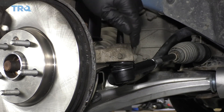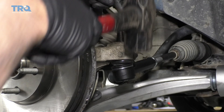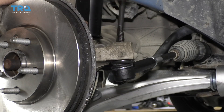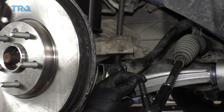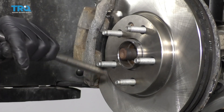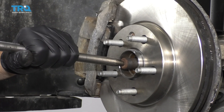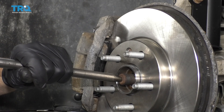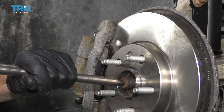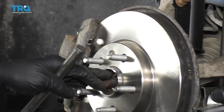Now I'm going to remove the stud from the knuckle. I'm just going to use a hammer and carefully hit on the stud — you don't want to mar the end of it or mushroom it. You want to make sure the axle is loose from the wheel hub, so just use a punch and give it a tap. Just make sure it moves in a little bit. I don't have to punch it all the way in yet, just make sure it's loose.